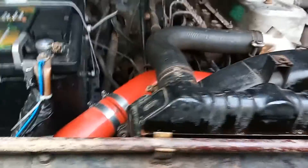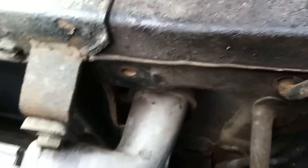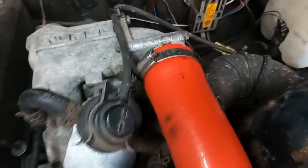Other extras — that is an intercooler from a Land Rover TD5. I've got it just behind the grille there, it's a snug fit. I feel huge performance gains — the engine feels a lot healthier, it breathes a lot better. The standard four-track intercooler has pipe in and pipe out on the passenger side, but the TD5 one is end-to-end, so what I had to do was buy a bunch of pipe and run it from one end through the middle and back up to my inlet manifold. I'd like to get a higher-flow one one day because I feel like it'll make a little bit more improvement.